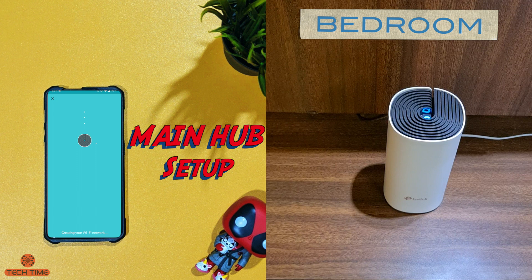While this is being set up, I wanted to point out the difference between Wi-Fi mesh systems and range extenders. Mesh Wi-Fi systems come with roaming protocols to keep you on the same network, plus mesh technologies such as self-healing and adaptive routing to keep your network stable. Range extenders, on the other hand, require you to sign in to a new network manually. Most range extenders are set up under different networks, whereas with mesh networks there are no other networks to worry about. Each mesh node functions as its own router, while range extenders merely duplicate the router's original signal.